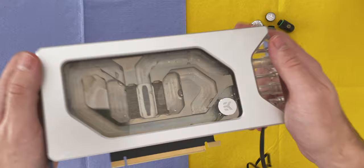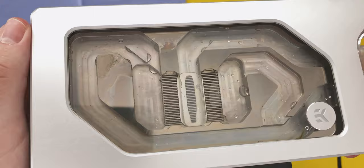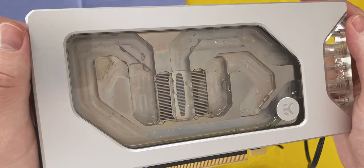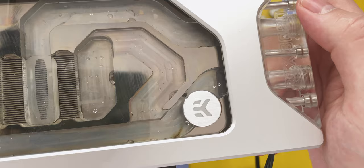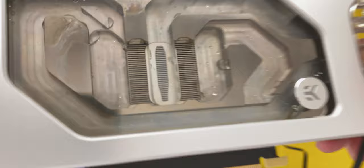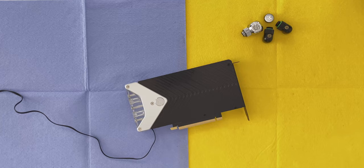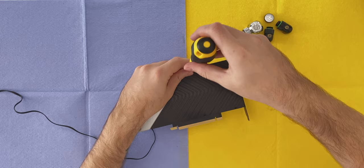I've been using the EK CryoFuel clear coolant, which should be the best choice for a low maintenance setup. I got in touch with EK and they assured me that these stains are normal. There's a tiny gap between the acrylic top and the metal surfaces of the water block — coolant gets inside and tends to create a halo or rainbow effect. I also noticed some strange rusty looking spots, and when I asked about those I was told it was most likely O-ring oil. So today we're going to give it a clean and see how many of those stains will indeed go away.